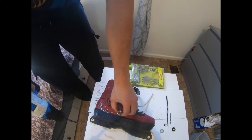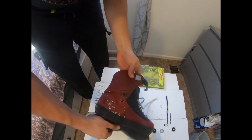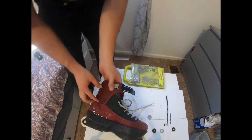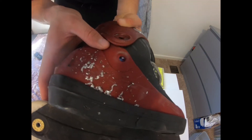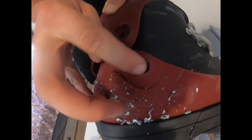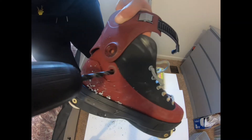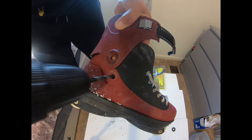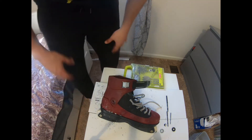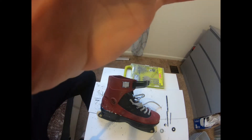It pulled right out — it's hot. It came right out and if you look, there's barely any damage here. The original drill bit I used is slightly smaller than this hole. So that's a 5/16th for your final step. Do that on all four sides and then I'll show you the rest.